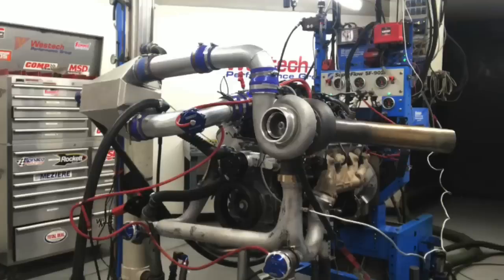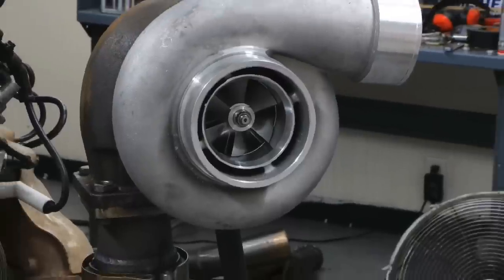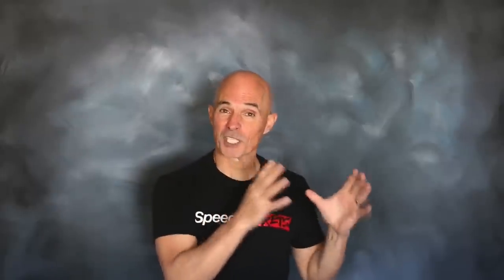What's the takeaway? What do we learn from this comparison between the 4.8 liter and the 454? For a lot of guys it's going to be: don't mess with a turbo 4.8 even if you have a big block. But the reality is something different. For any given turbo size, sometimes it's easier to make more power with a smaller motor than with a bigger motor, because of the back pressure produced by the bigger motor. You need to size the turbo correctly — not just for your power output, but for the motor you use to get there. A 1000 horsepower 4.8 liter will require a different turbo than a 1000 horsepower 6 liter, 7 liter, or even 454. Make sure to choose the turbo based on the power output and the combination you use to get there, and good things will happen.